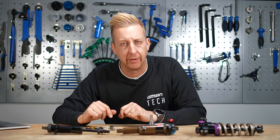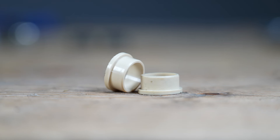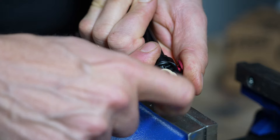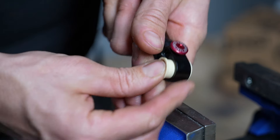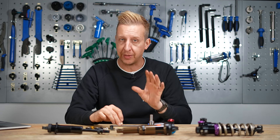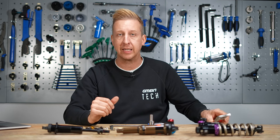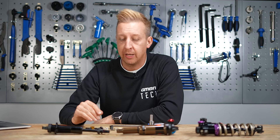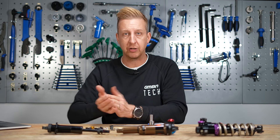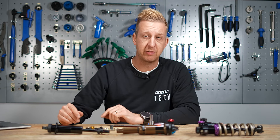What is the difference between them? The advantages of using the poly-style: they're easy to fit and easy to remove. Because they're in two pieces and push in, they're very easy to hook out with a screwdriver. Quite often you can push them back in, and at a push — without even a vice — you could use a tool to push them in place nicely. That's very convenient. However, they do wear out much faster. Marzocchi and Fox spec those typically as standard.